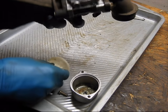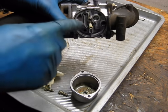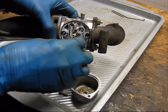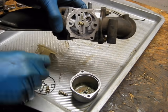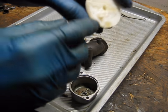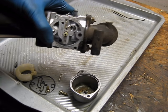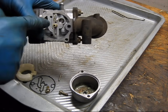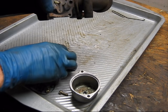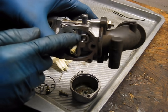The other piece I want to talk about is this base gasket. There are two kinds of gaskets for these: there's one where it's all one piece, and then there's one like this one where it has the main base gasket. And then if you look right here, this is your fuel inlet O-ring — it's just an O-ring and it goes around this little nipple right here, and that seals the carb body to the fuel inlet. There's one other kind of gasket where that part is actually built into the gasket. But this and the needle is usually where a flooding problem occurs. If you look at this one, it looks like it's in really, really crummy condition — so this is actually probably what's causing our flooding problem.